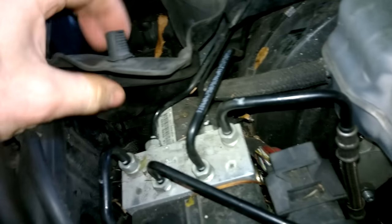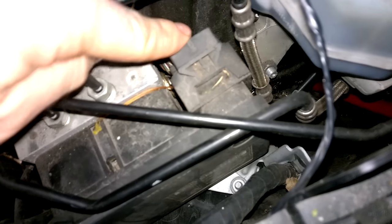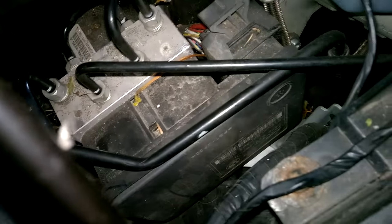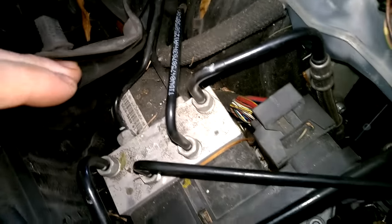I'm going to jump into the second part of this video now, which shows me actually removing the unit and then the separation of the hydraulic unit and the DSC unit to fit back together again. Just down here there was a cover that I've lifted up and pulled back to make room. The next steps are to disconnect this item here, and down below there are three nuts to remove that hold the whole unit down in position — I do believe it is just those three.